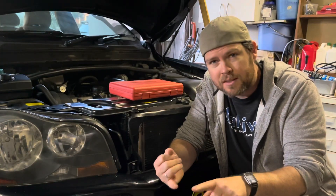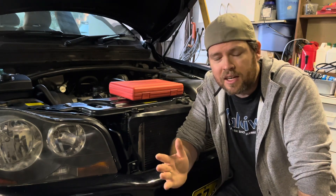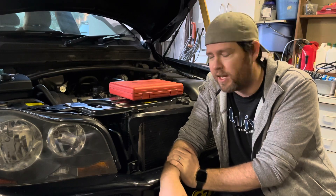So we've got a dead cylinder 3, and we know it's not the spark plugs, we know it's not the coil packs, and we know it's not the injectors. So basically it's going to be something internal in the motor, and so what we can do next is a compression test. I try to keep things basic on this channel — I'm not a mechanic, I don't have very many skills, I just like to play around. The idea is just things you can do at home, and this is something you can do easily and cheaply.